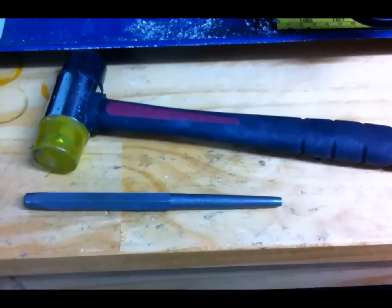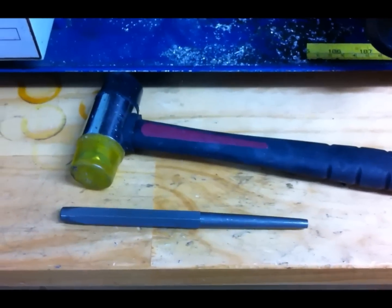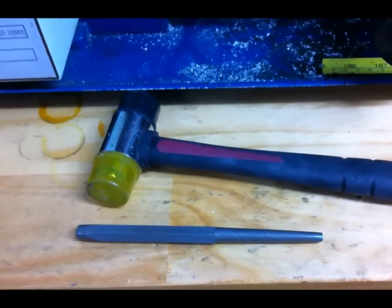There's the oil cooler feed line. To do the flushing operation you'll also need to remove a bracket screw on the left-hand side of the engine sump — undo that to release the oil cooler feed line pipe so you can pull it out and give yourself enough room to put the fitting on the end to flush it. I just used a punch and a nylon hammer inside the oil drain hole in the pan — you can feel the end of the overflow pipe. Give it a slight tap and it comes off, falls over inside the pan, and the rest of the oil runs out.